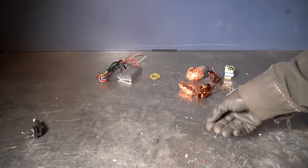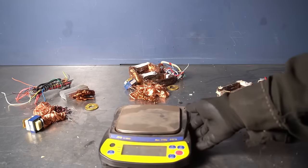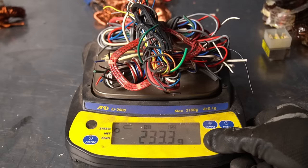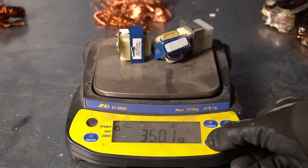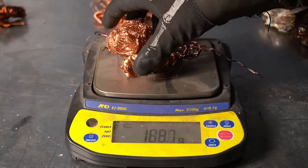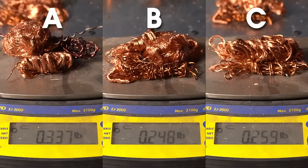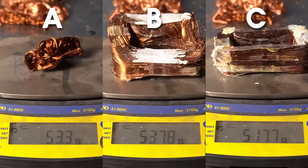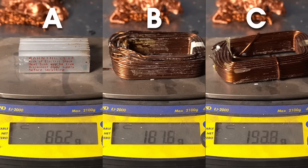So there — one microwave done. Let's do the other two and compare. The weights on some of these are going to be so small they're inconsequential, so we'll just get an average. The mixed wire yields about half a pound of mix number two. These tiny transformers are about a quarter of a pound — like 10 cents each. But looking at all the copper from the smaller surrounding components versus the transformers, it gets wildly different: ten times as much in the chunky transformer units — more than a full pound. The aluminum yield is pretty much the same across all three.